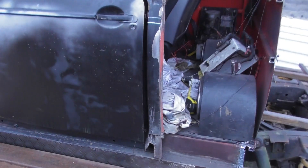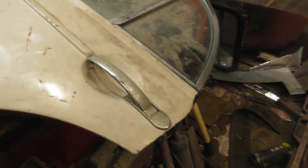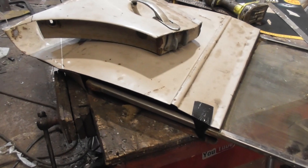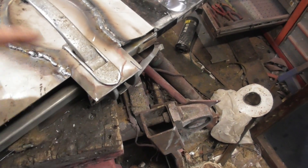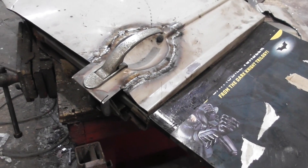We're going to have to approach this door from a different angle - we did speak briefly about that. I need the door cutting, that's basic. I'm not really sure what I'm doing with it or how I'm going to do it. This line is a nuisance - everything is a nuisance on it. There's no coming back from that - I cut it out, I overlaid it, I had to put an extension out to here because, as you can see, I want to try and use everything original. So I've overlaid it. The welding is not great - I've never been a tin-welding man. I could have put a crease around there for a sink-down, but I chose not to - whether I'm going to pay for that later I don't know.